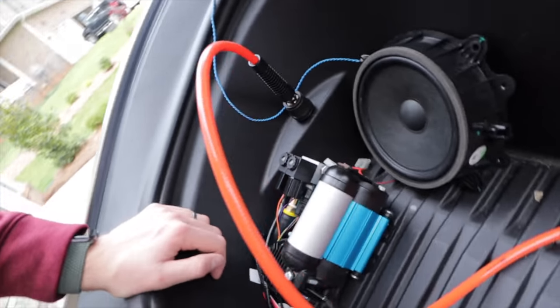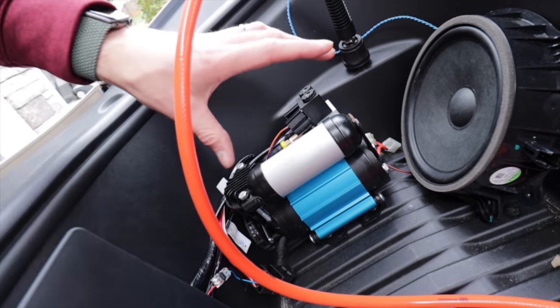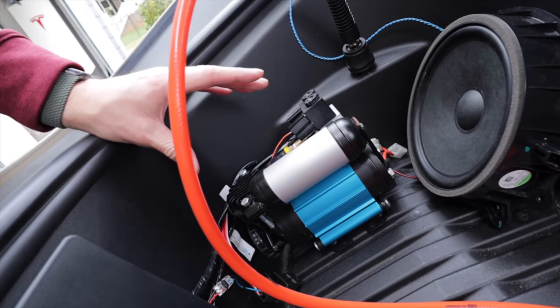It's kind of hot but not too hot. This is rated to run for an hour straight - that's the good thing about ARB compressors. They're high pressure and made to run for a long time. Your average compressor you buy at Walmart is only good for maybe one tire before it gets too hot and burns up. This is good to run for a complete hour and then it needs to rest for an hour. I'm very curious to see how long it takes to do all four tires. Let me get all the parts and pieces out and show you how I'm going to hook this up. Maybe your compressor isn't up front - you can route the lines however you want.